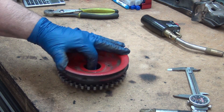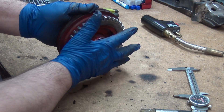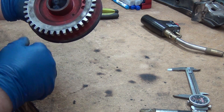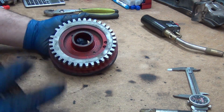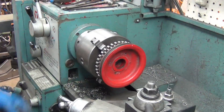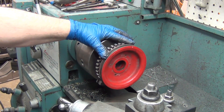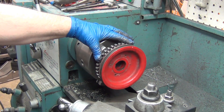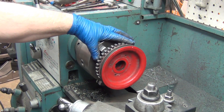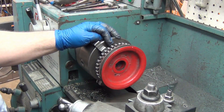I think I'm going to put it on the lathe one more time and tap it around to get it perfectly true, then take a last skim coat — well, I want to see how close it is. If Luke can get it to spin true when he puts it on, I'll leave it on there like that so he can see what it takes to pop it back off. This is on there tight enough that he could probably even start the car and check it, then be able to move it. I'm really damn pleased with how well that came out. That ought to do the trick.